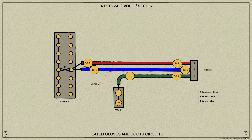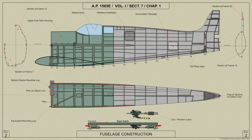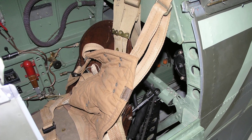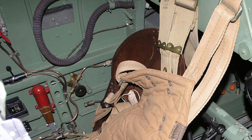The socket for the pilot's heated gloves and boot supply is fitted in the starboard side of the cockpit at the top of frame 10 in such a manner that the connection will automatically break if the pilot omits to disconnect when leaving the aircraft. The space between the oxygen pipe and the aft side of frame 10 forms a stowage for the socket when the latter is not in use.